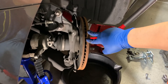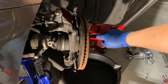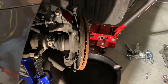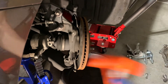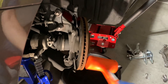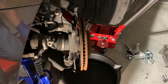For those of us who live in the rust belt or up north where road salt is used, you might have difficulties getting this rotor off. You'll want to spray some penetrant like PB Blaster on the hub here to help get penetrant oil in between the wheel bearing and the rotor. But here in the desert southwest things don't fuse together, so I'm just going to grab a nice dead blow mallet and hit it and see if this rotor comes off. Not too bad — I'm from Alaska so these things usually fight you, but we got the brake rotor free from the wheel hub.